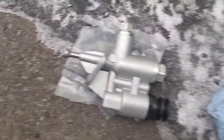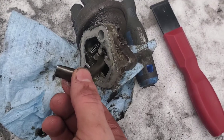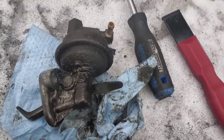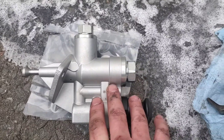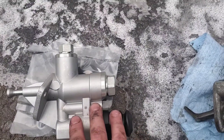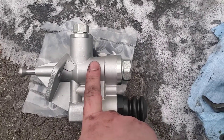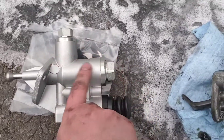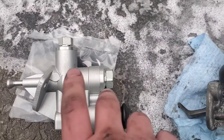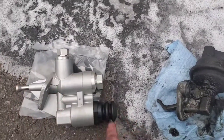Here's the old pump next to the new pump. The old one is driven by this cam off the camshaft and uses a diaphragm to pump the fuel. The new one is a piston-driven lift pump — these are seen on some other Cummins engines. With the VE pump on first-gens, a lot of these piston pumps put out too much pressure, so you get the one from Hungry Diesel, which already has the springs set for the correct pressure so you don't blow seals.